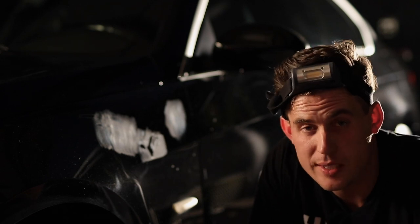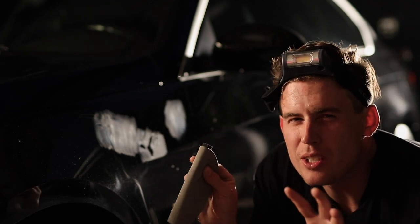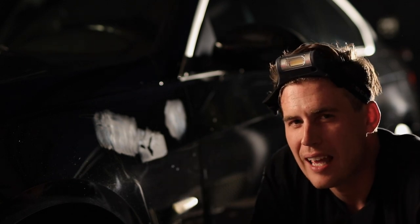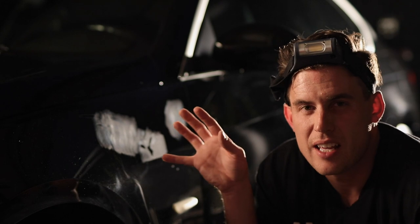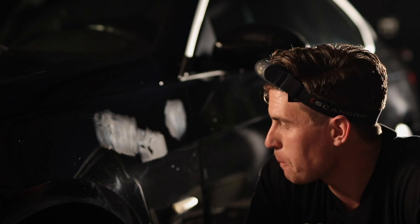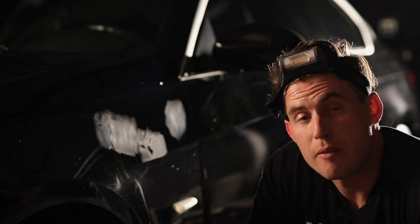You might call me a little crazy here, but I am doing some spot sanding and that's because I know myself — I'm going to want to go after scratches and I'm going to get too aggressive. The paint's going to get too hot, it's going to swell, and we do not want heat as we go about polishing a vehicle.